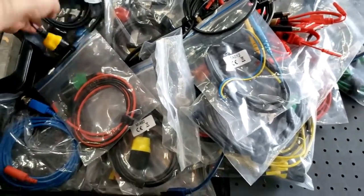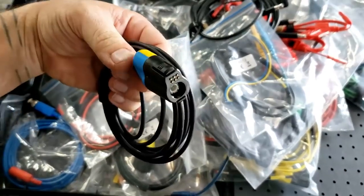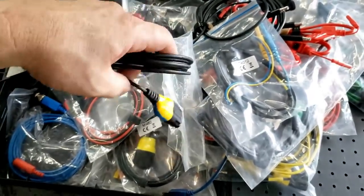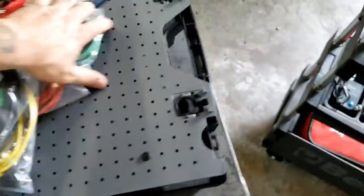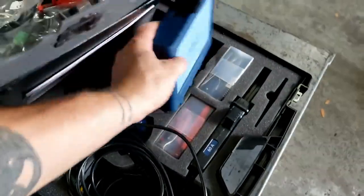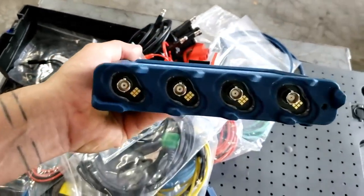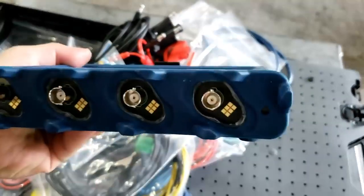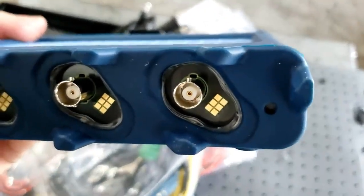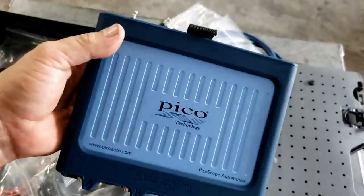No big deal. It's just cool to buy the kit and have these BNC Plus leads, where a large percentage of the stuff that you're plugging in, it automatically detects them. This is the thing that I was referring to a moment ago. I forgot, and I apologize. But this being the 4425A, of course, the beauty is the BNC Plus. Again, you can use your regular BNC stuff on it, but those small little 6 contacts there, that's what determines which probe you're putting in, so it automatically detects it.